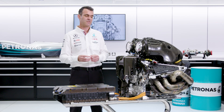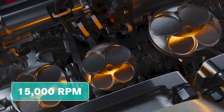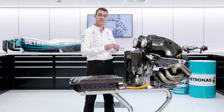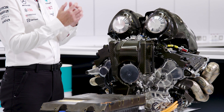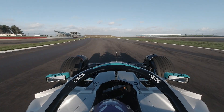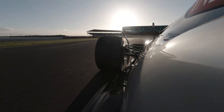Where it's very different is some of the details, and it's really in that detail that it is different. We have an engine that's rotating at 15,000 revs per minute, significantly quicker than you would on your road car. That means that the combustion is happening ever so much more quickly. Within the blink of an eye, we have 200 combustion events. And the detail that has to go in to make that work and to produce the power that we need to power our Formula One car — that's where the differences really lie.